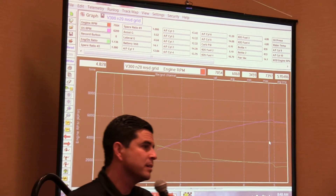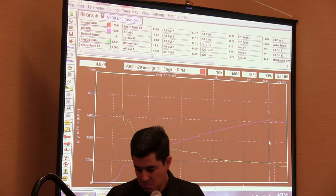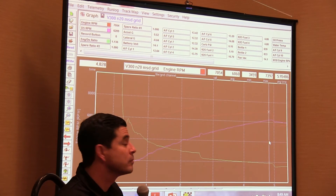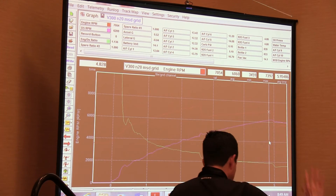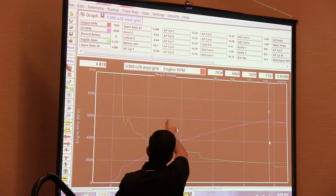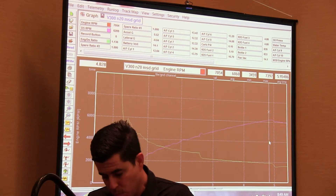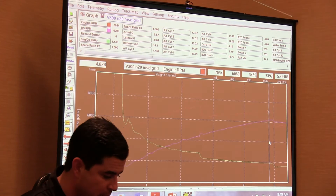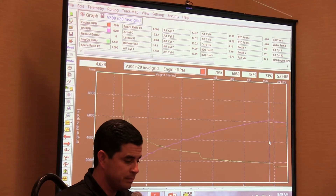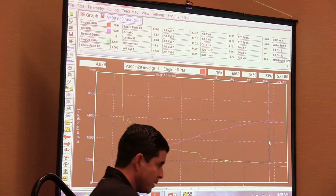This is also great for you to overlay, to see if your converter's going away. If that gap starts getting bigger and bigger, well, maybe we've got a problem. It's a ratio, so we don't look at the 1 — we just look at after the decimal point. For those that run clutch RPM, we can actually put a clutch percent slip in there that will actually read the percentage of slip. So if you're 3, 4, or 5% or something like that, you'll be able to see that in the data.